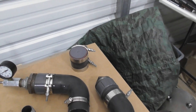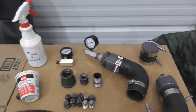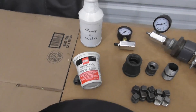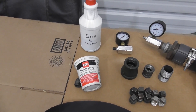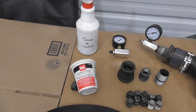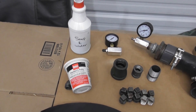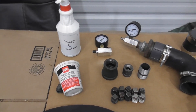Here's a silicone cap, and here's one with a 90-degree fitting with a plug. For testing the water, you're going to need some plumber's putty. On the bottom plate of the reactor, the bottom plate of the filter, and the choke metal, we use the plumber's putty to make a little dam — a little water reservoir — to test for leaking.